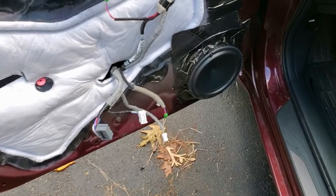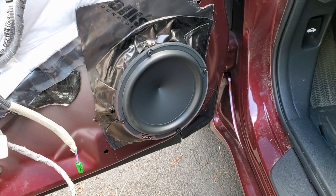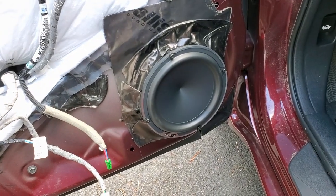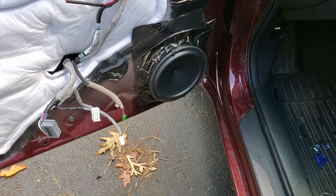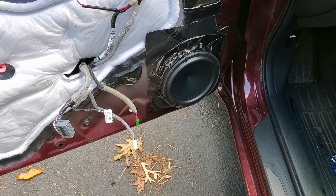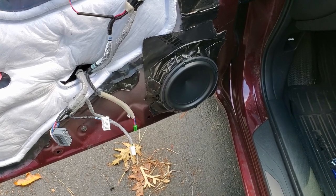Here I'll show you the video of the driver installed. You see there's a lot of dynamatting around it — ballistic matting. We did that to make sure everything was sealed. Apparently my friend didn't get it completely fully sealed, so it's very important to get a very good seal; otherwise you can lose sound quality from your speaker. One other thing to watch out for with some of these Metra install kits: the rings themselves sometimes have little plastic nubs on the back that can push against the door and break the seal, leaving a little space between the mounting ring and the speaker. You might want to shave those nubs off.